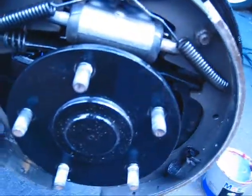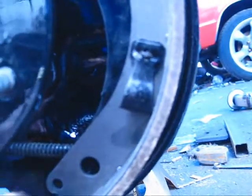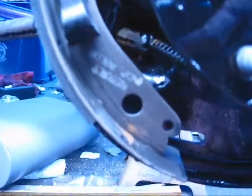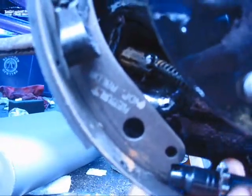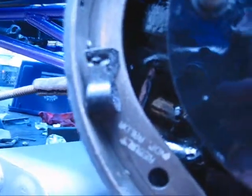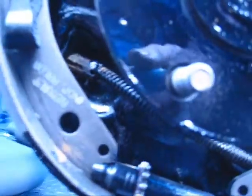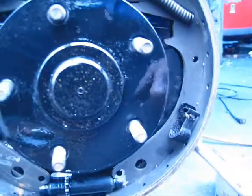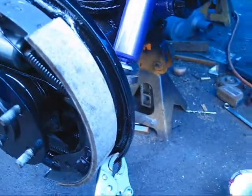This brake here is going to actually be moved, and then this rod that goes across is going to pull that front brake — that'll do your emergency brakes. Now for the adjuster down here: there'll always be a hole in the bottom where your teeth are going to go, so you want to screw this all the way together and then put it on. I put my little adjuster in and slammed it all down so it's closed up completely.